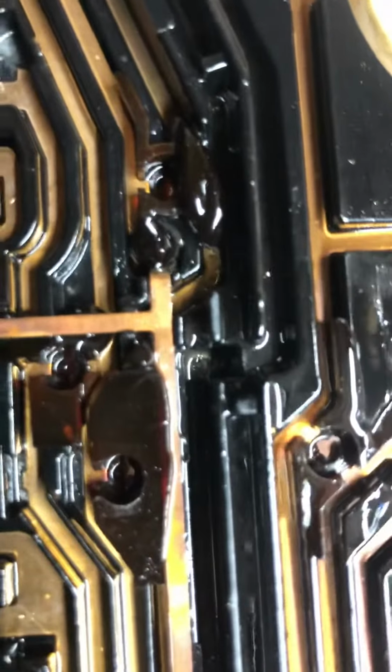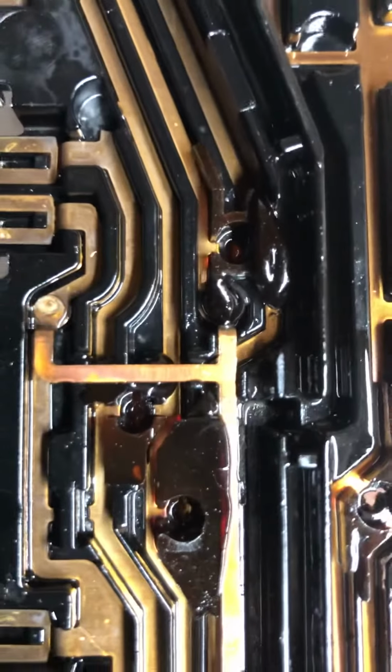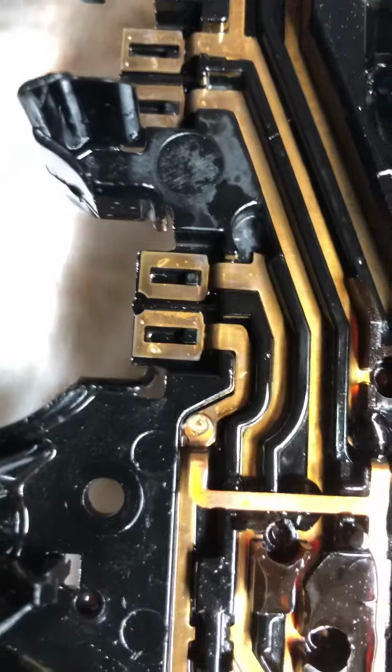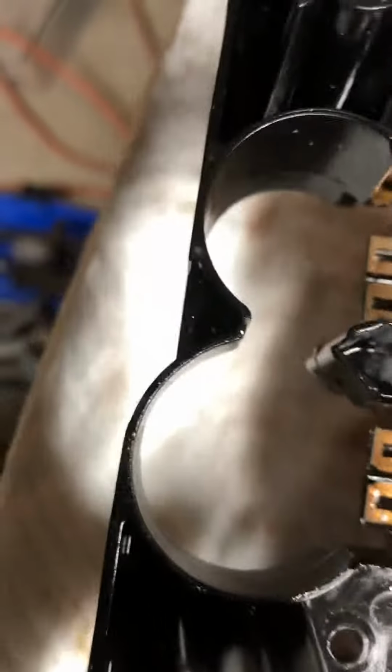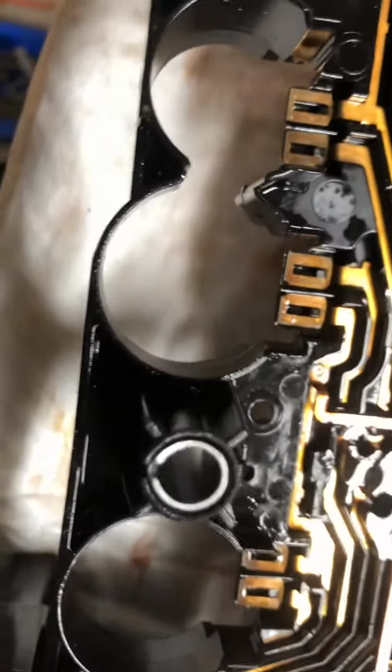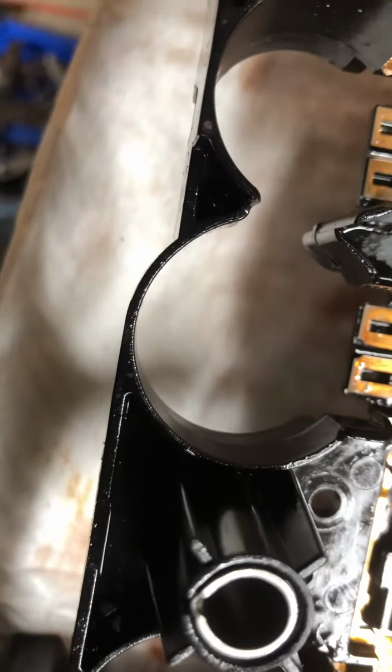But I did find a few places where the wiring or the copper strips seem to be thinning, like there. You can actually peel that from underneath a little clip, or the little plastic that's melted as it's held together. And then I found a real dirty contact point for all the solenoids. Let me clean that as well. But it's just kind of odd to me that just this one specific wire here is starting to show a lot of burning.